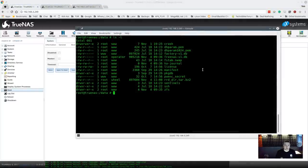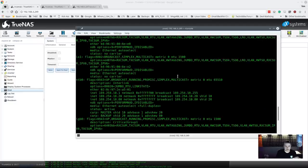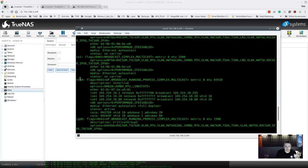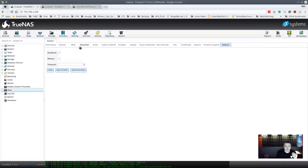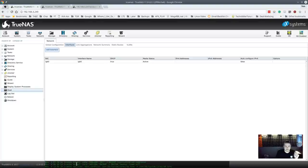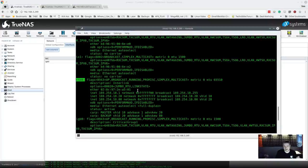There's also a failover option to force syncing in the other direction if needed. I'll show more of that in the separate HA failure demo video. Now, you may wonder how the two nodes communicate with each other. There's an NTB (Non-Transparent Bridge) bus network for CARP — they don't use the external back-panel network interfaces to sync the two systems. Instead there's a dedicated internal interface for the two nodes to talk to each other.